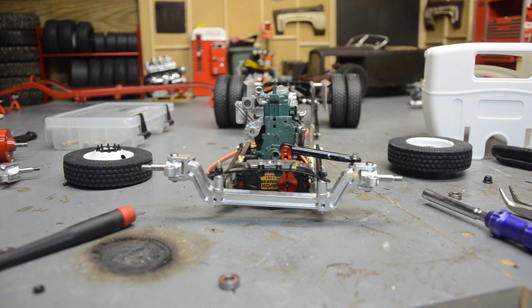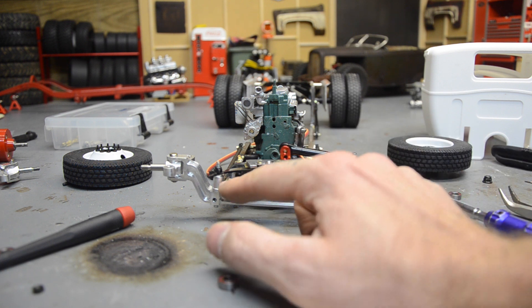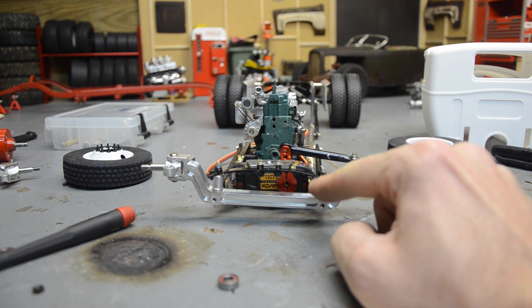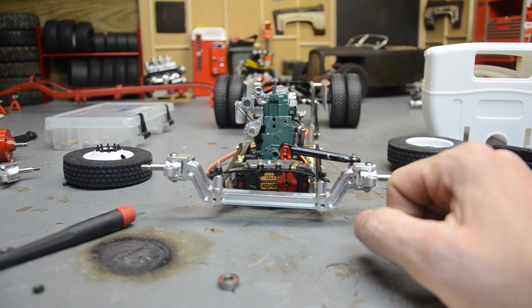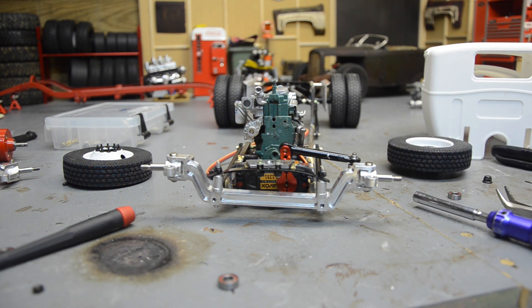Working a little bit - here's where I'm at. I went ahead and used my other new axle instead of trying to strip the old one down to drill it out. It's all mounted up and it's completely crooked, and the reason being these spacers I used here were larger diameter inside so they're sliding all over the place, I can't keep them straight. So I've got to come up with another alternative to this spacer, and adjusting this length here will also allow me to adjust my ride height in the front. I'm running out of the suspension spacers and having a hard time finding them in bulk. I'm gonna take that all apart again and try to come up with something that'll fit that bolt a little tighter and give a much better look sitting there straight - but it does work.